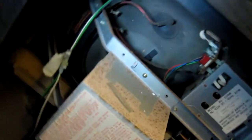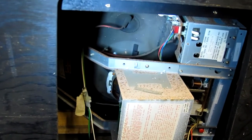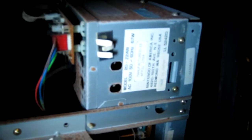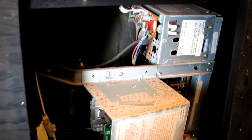What's happening is, after it's warmed up for about 15 minutes, it starts ticking and making an arcing noise. I don't know where that's actually coming from. I'm going to take the anode cap off and clean it up, just in case that's anything to do with it — it is a bit dirty around there. I suspect it's probably going to be in the flyback area, which is unfortunately underneath this shielding, so I'm probably not going to be able to see anything. What I'm going to try and do is set a tripod up behind the machine and see if I can capture where the arcing is coming from after it's warmed up.